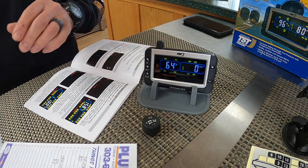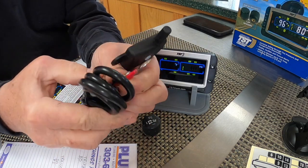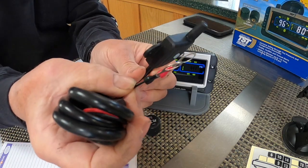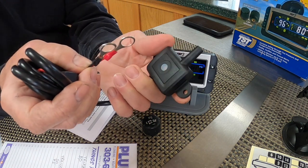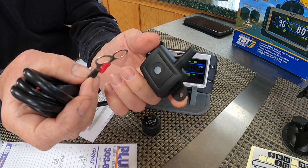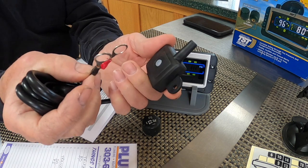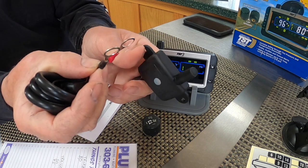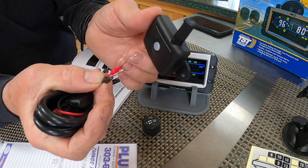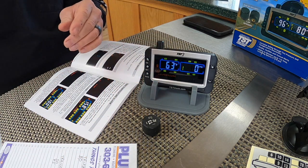You'll also get a repeater. So here's the repeater, and it's just a positive and negative 12 volts DC connection somewhere. And I'm going to put this up into the bay of the trailer. A lot of people do that. And I have keyed power from the truck coming in into my DC to DC charge controller, so the only time it's powered up is when the truck is on and the 7-pin connector is plugged in. So I think I'm just going to put that in. We'll go do that. Screw the sensors on, and pretty much that's it.